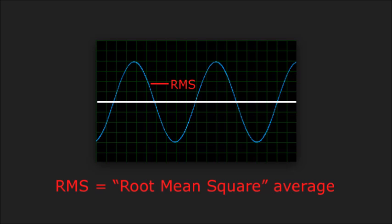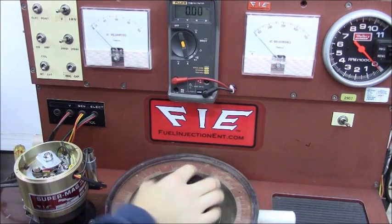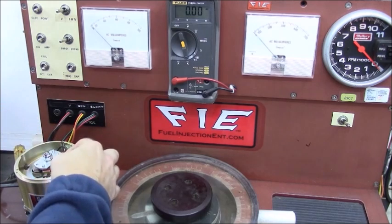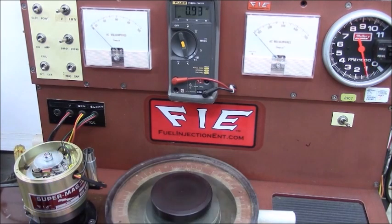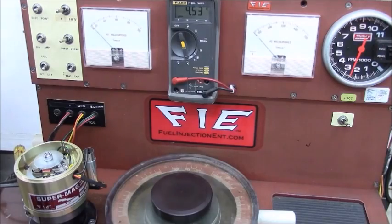In RMS, a root-mean-square value is a useful way to express AC electrical power. Since the early days of magnetos, most mag shops measured the AC magneto output in terms of RMS current. They used either an analog or digital meter, blocked the points open, and spun the mag at a certain fixed RPM and took a reading. It's quick, inexpensive, and fairly repeatable from one place to the next. While everybody was using that same method, everybody knew what the number meant and what they were getting.